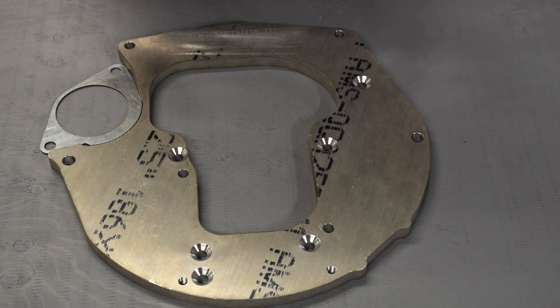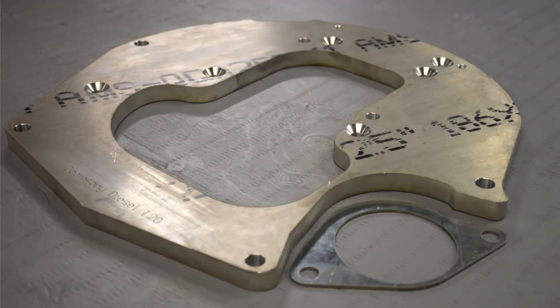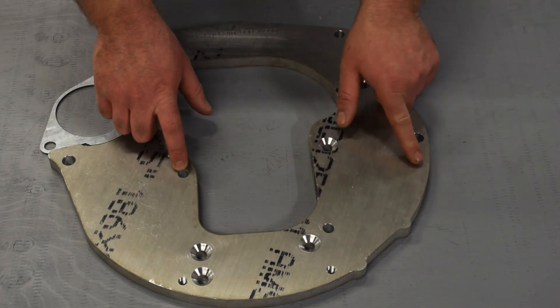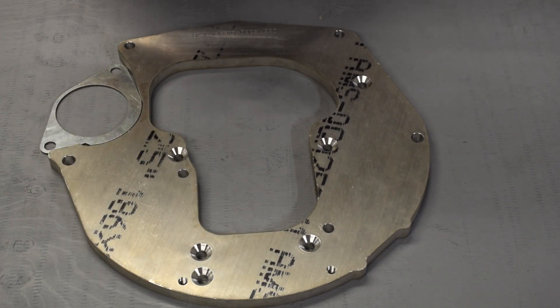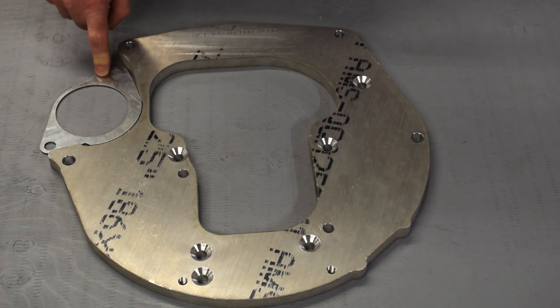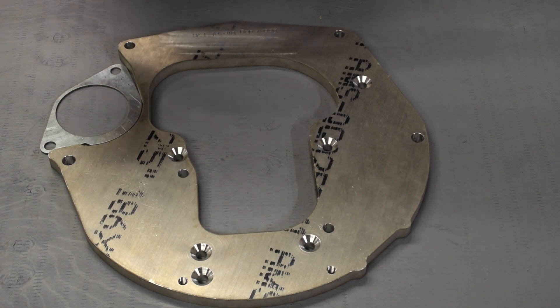Looking at the Doomsday Diesel kit versus the Mercedes Diesel 4x4 kit, the first and most obvious difference is the adapter plate itself. The Doomsday kit is made out of aluminum — a 5/8-inch thick piece of 6061. It's been rough cut on the outside and inside dimensions with a water jet, however the dimensions that really matter — the dowel holes — have all been cut using a mill, so you know they're exactly where they should be. Because this plate is thicker, it works with their crank adapter to space the flywheel to the correct depth. A shim has also been provided which acts as a dust shield to close off the starter hole in the adapter plate, ensuring the starter will engage the flywheel correctly and the clutch should work fine.